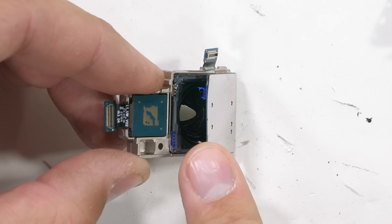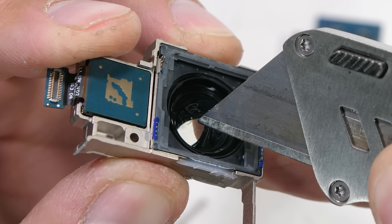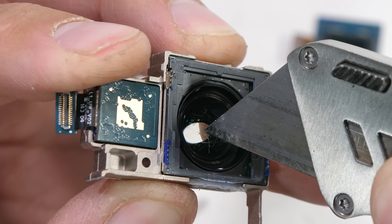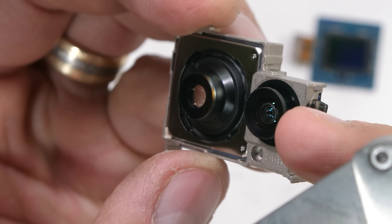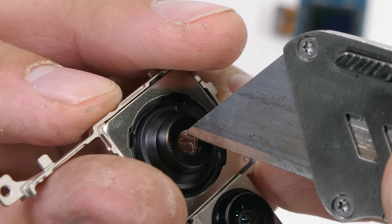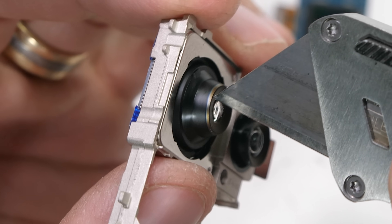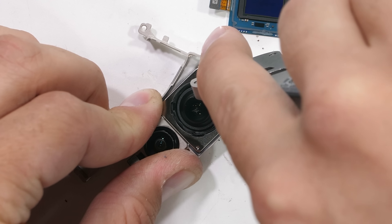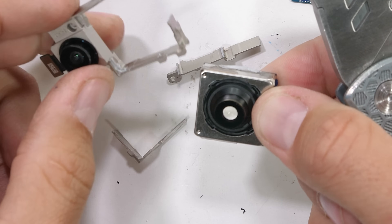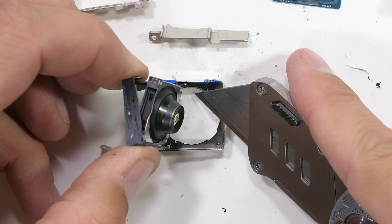With the 1 inch sensor popped off the back, we have access to the internal lens elements. It looks like both sides of the lens are made with plastic — I'm mostly curious because some photographers have a very strong preference for glass on professional camera lenses, but on something this small, glass is probably not super feasible. The main camera also has optical image stabilization using those same copper electromagnetic coils that interact with stationary magnets inlaid into the sides of the lens elements. All pretty standard.